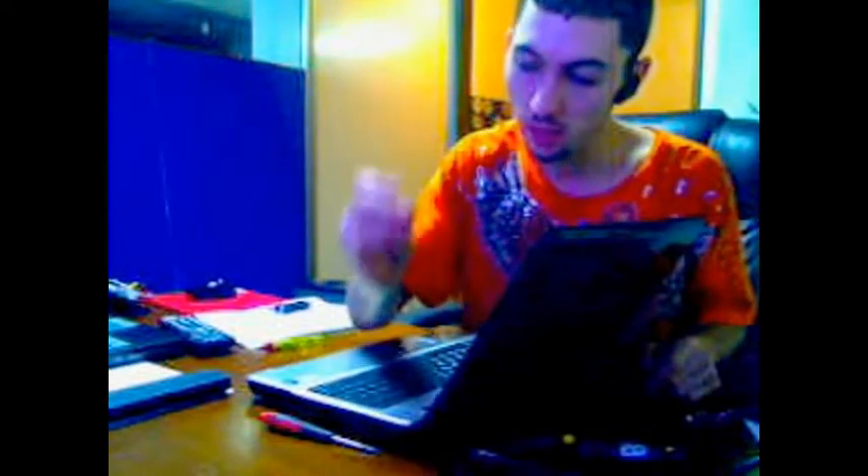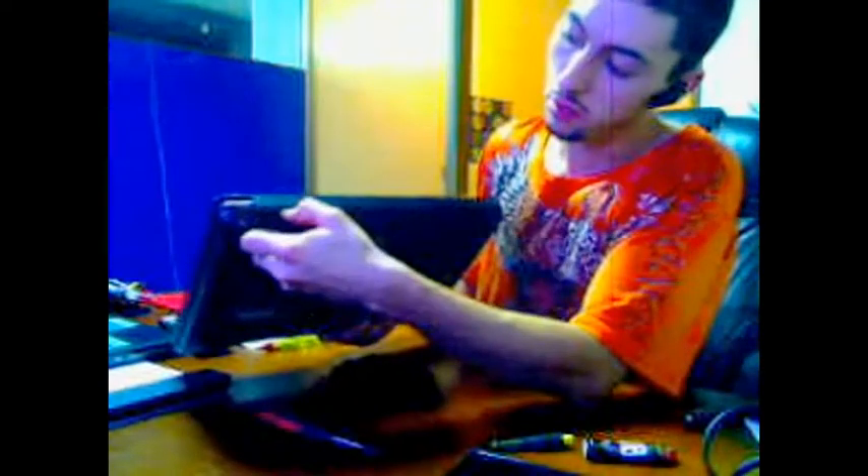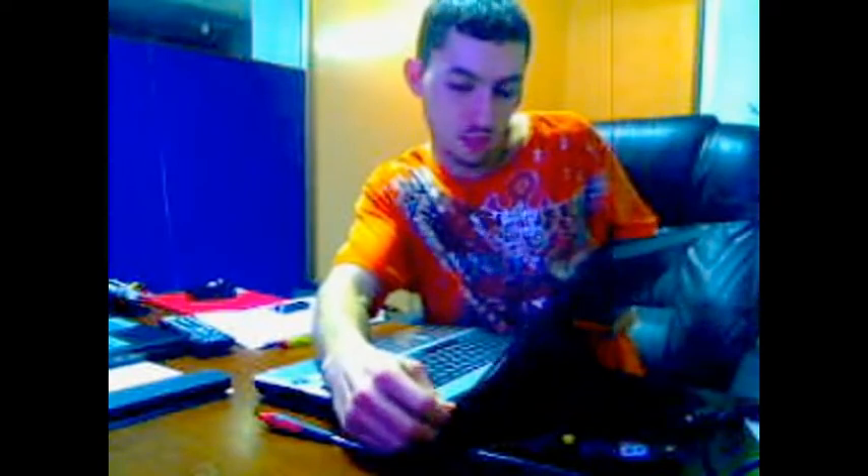Alright, we're back. Once you get the two screws out — which are kind of small and might be a little difficult — just get a small screwdriver in there, work them the best you can, and be careful not to strip them. Then flip the screen down. Behind it there's a little face plate with some clips. Use a prying tool to gently pop them up, make sure there's a little space, then open it up and gently wiggle the corners and it's going to come right out.